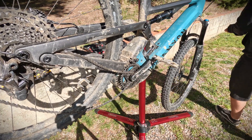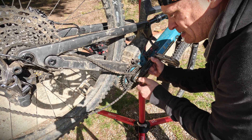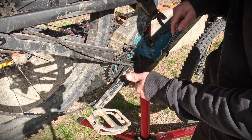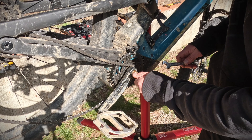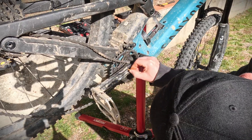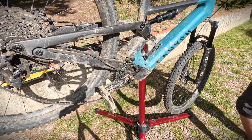The crank puller is basically a bolt inside a bolt and you have to be very careful as you screw it in. I've lubricated it a bit — screw it in straight, make sure the thread goes in straight. If you haven't got the right crank puller, the way to make this crank puller work is with a one cent coin — you see it should fit in there, so you've got something to push against.